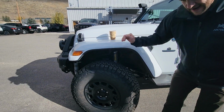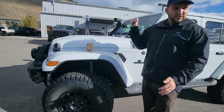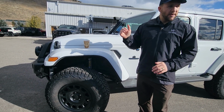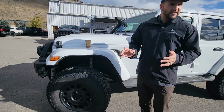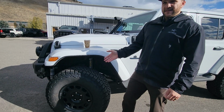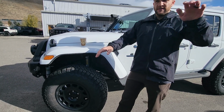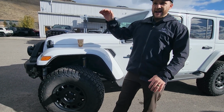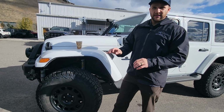Then you go progressively down the spring and you have a softer spring rate. That's completely the opposite. So if you sell this to a customer that's single by themselves, that's going to drive around year-round with the doors and top off, that softer spring rate can handle the lesser load and it's not going to drive really stiff. Okay. The other thing that does is when you're off-roading, the soft spring rate allows the spring to flex, so you get the travel to keep your tires on the ground, more articulation. If you're going over sand dunes or slow crawling, it still gives you the flex in the axles. So you get the best of both worlds.